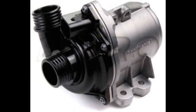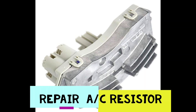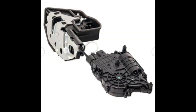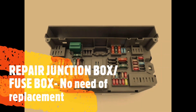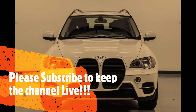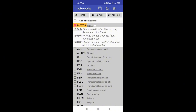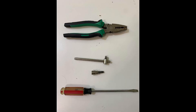The problem started after adding an oil additive due to high oil consumption. I tried different oil additives from big brands but it resulted in waste of money and more problems. I tried cleaning the VANOS solenoids on the exhaust side but it didn't last more than 500-600 kilometers before the drivetrain issue would pop up again. After reading the codes multiple times, error code 130304 appears with bad oil, and 130204 if the VANOS solenoid is completely dead.